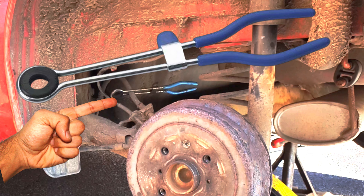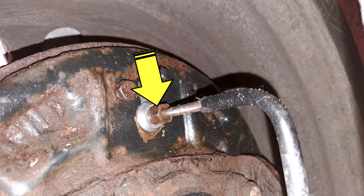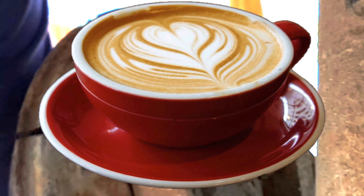Make sure to fit a good quality brake hose clamp to the brake hose. On the rear side of the back plate at the top, find where the bleed nipple is, the brake pipe and its union, and the screw that holds the wheel cylinder into place. With a small steel wire brush, give it a good wire brushing — particularly around the pipe union — to get rid of as much dirt and corrosion as possible and make it as easy as possible to undo. Then generously apply some penetrating spray around the pipe union and the screw that holds it in, and go and have yourself a cup of tea while you wait for that to soak.